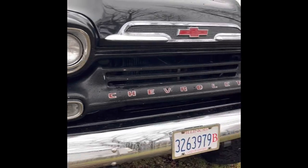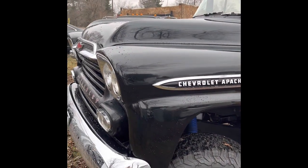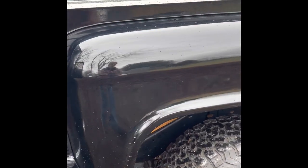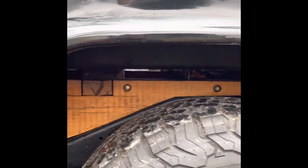The cab is the original cab. The hood and radiator support are still steel — also original. It's got a new radiator, all new accessories, all new brakes, all new lines, and an all new fuel system. These old trucks had straight frames; the newer trucks have curved frames. So what I did was cut wood scribed to the frame — I made this wooden piece that's four inches thick that sits on top of the frame.